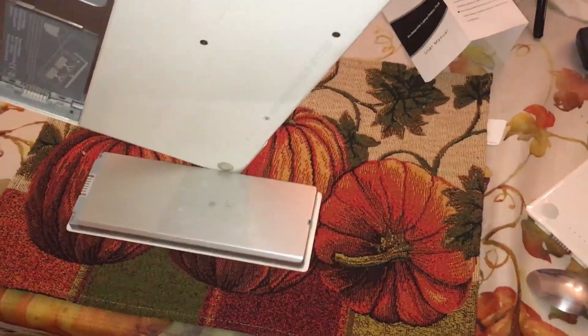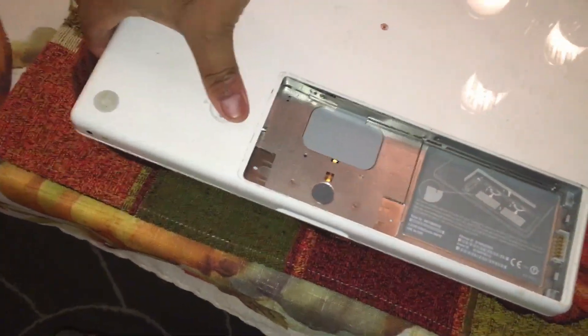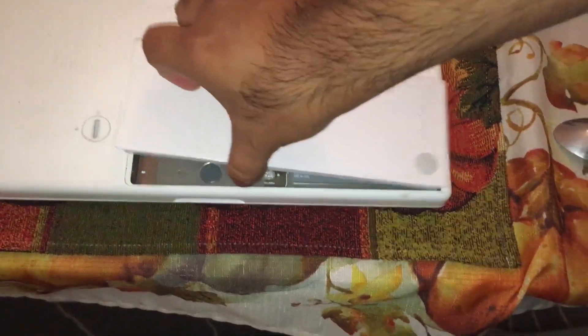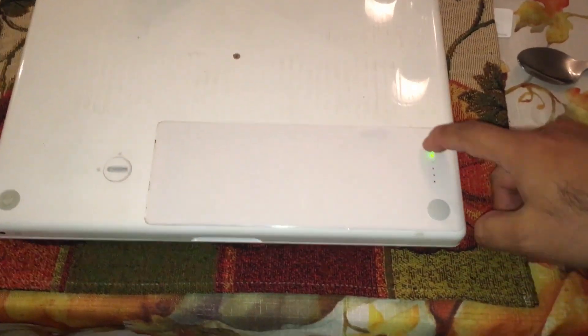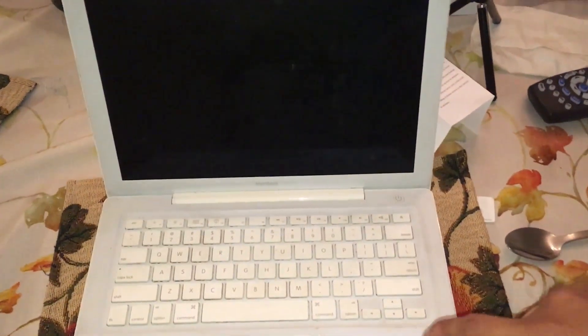Here I'm removing the old battery — it doesn't have a charge at all, doesn't recognize it, just dead weight. Then I grab the new one and install it. It looks a little different — the new one is plastic while the original is aluminum — but that's fine. You insert it, push it down, and lock it in place with a quarter or the back of a spoon. This battery actually has five dots representing 20% increments of charge, whereas the old one had only four.